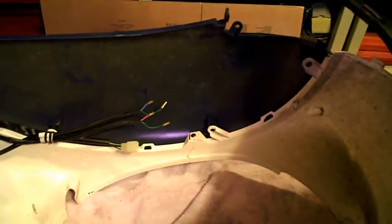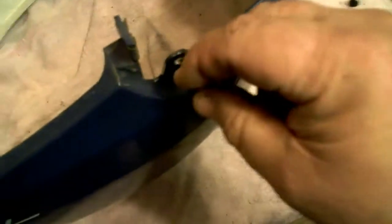I wanted to show this — this is the floor pan that was on there. I had already removed it and wanted to show a little bit of how it came apart. Really nothing to it. It kind of went together like this — it sat together with some little guides that fit into it and it just comes off. There are these little plastic buttons that held it on. The little trick is you push the center part in, it expands and makes it so it comes out real easy.